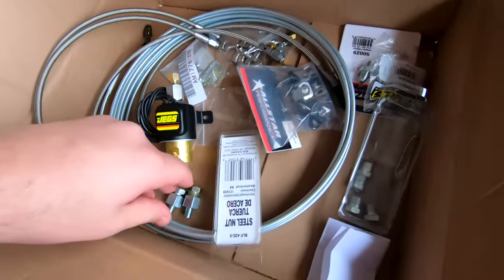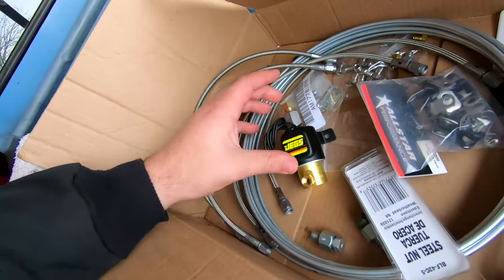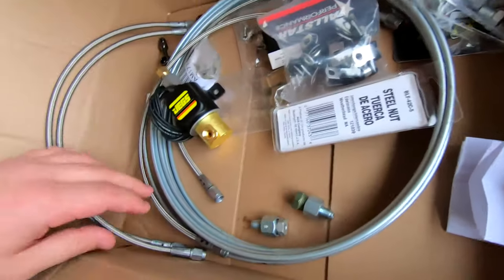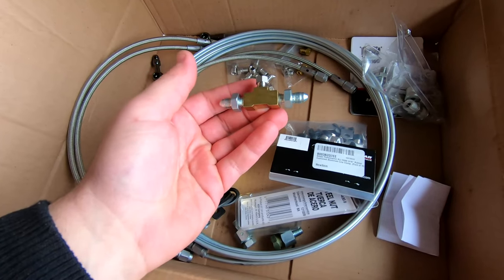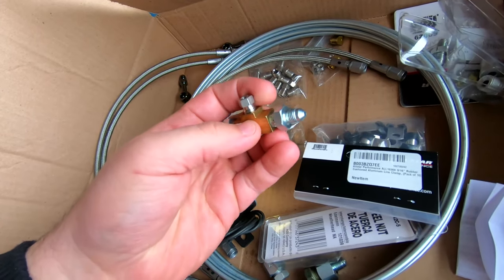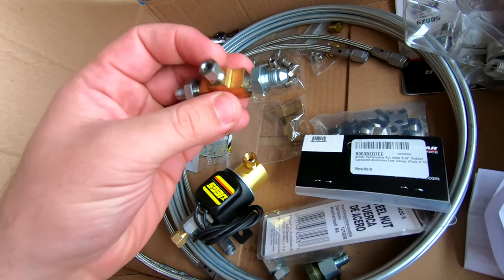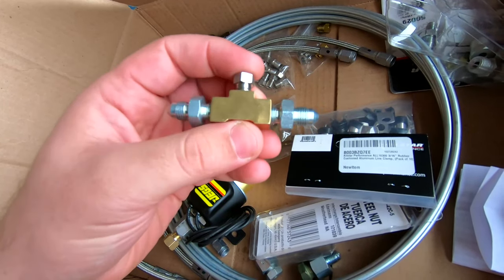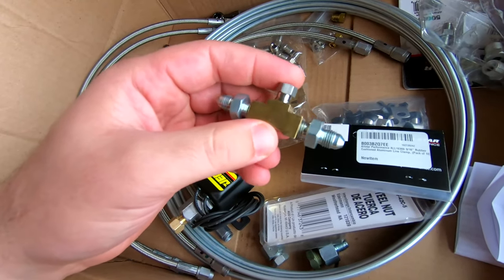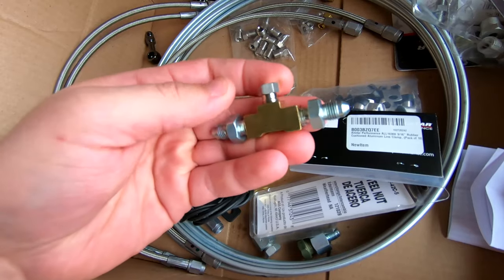These are all the parts needed for the rear and some for the front. I've got the master cylinder nuts, the brake line itself — the brake line will go through the solenoid and then to the rear where it'll tee off. For anybody curious, the AN size to use for brakes is dash-3, and conversions from 3/8x24 threads per inch are easy to find — that's the fitting size the Wilwood brake calipers call for, so I decided to do the whole rear system in that.